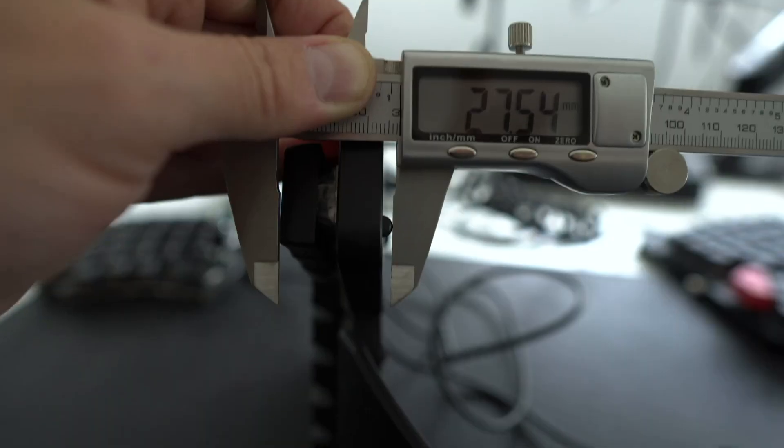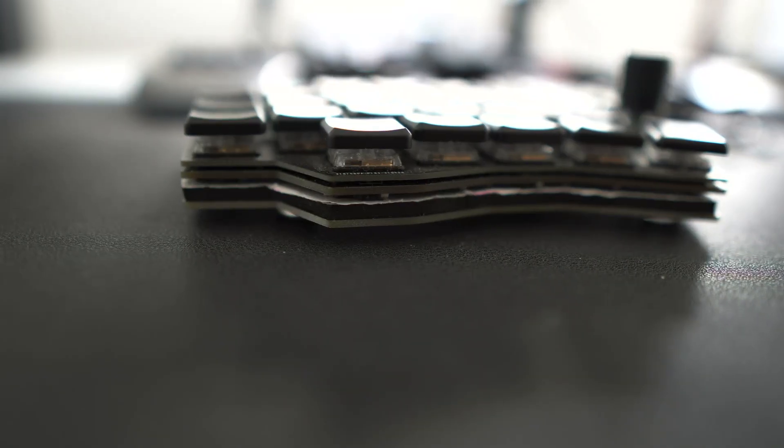Physically it is very low to the ground. It came with little 10mm spacers that go between the two plates, and once that's on with the feet it's somewhere between 20–24mm to the top of the keycaps. Something like the Moonlander with DSA caps only comes in at 27mm, so despite having choc switches it doesn't end up being that much lower. The way it's constructed: you've got the PCB in the middle, two sandwich plates either side, the top plate has the keys and switches sitting in them, and standoffs between the plates give you the distance so the bottom of the switches can sit under the PCB.